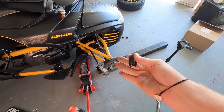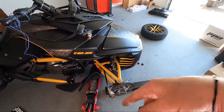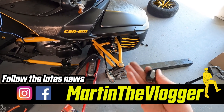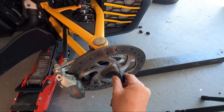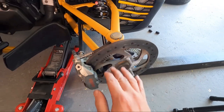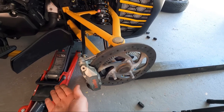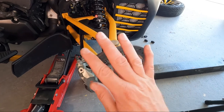All right — how to do the job. You can see I don't have the wheel on already because we're putting new wheels on anyway — different story. But if you don't know how to remove the wheel, this job probably isn't for you. Just to tell you: clockwise tightens the screws, anti-clockwise removes them. First have the bike completely on the floor, loosen the screws, raise the bike, then fully remove the screws and remove the wheel. That's it.